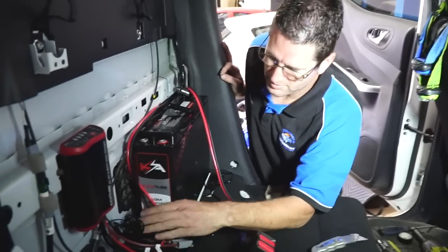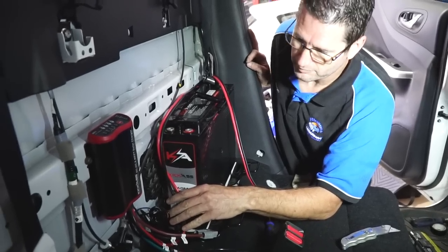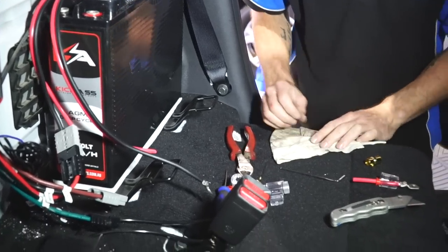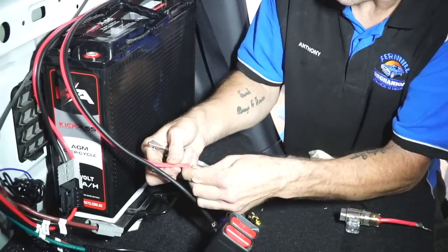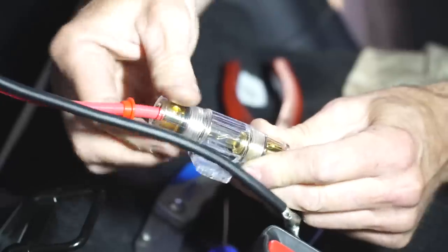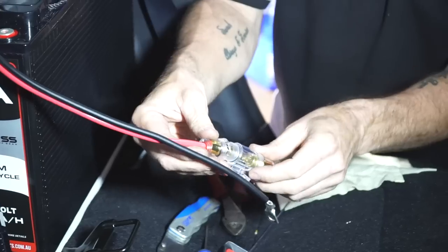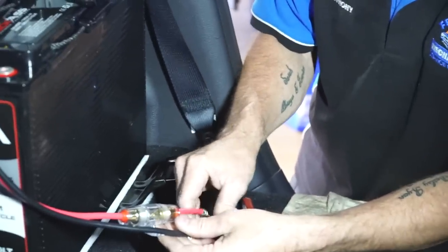The solar connection does exactly the same thing as the car battery - it just comes in from the sun rather than your alternator. That's the fuse for the inverter line. You're going to need at least one spare fuse to take with you in case one blows. Once it's finished, if anything overpowers or over-surges, the fuse will blow before the charger, inverter, or anything else. You should really have fuses on all your electrical setups.